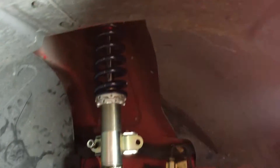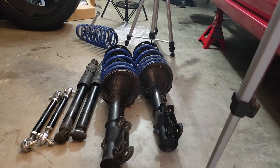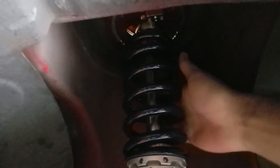We did put on the MCS suspension — haven't hooked up the knuckles yet, so I'll need to hook that back up and set the ride height. Now the MCS is bolted in, and one thing I noticed is that the spring diameter is much, much smaller. Look how much bigger the springs are in the Eibach Pro Damper setup by comparison. Because of the smaller diameter, combined with the Vorschlag camber and caster plates in the strut tower, I'm going to have a lot more room to adjust camber and far more overall adjustability.